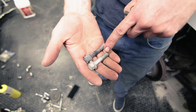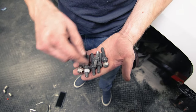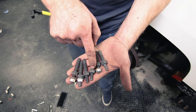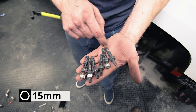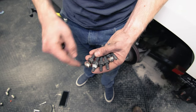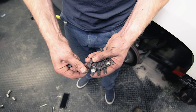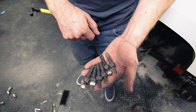There are two normal bolts located at the bottom of the transmission — these are going to be extremely easy to get out. There's two at the top that are quite challenging to get to; we actually went from the top of the motor with a ratchet wrench. Then there are four remaining ones. The larger nut on the stud is 15 millimeter — that's actually part of the stud that comes off together. Some of these have a smaller nut and washer; these are holding brackets and are 13 millimeters. For those, you have to remove the 13 millimeter nut, pull the bracket off, and then access the 15 millimeter nuts underneath, and the entire stud will come out.